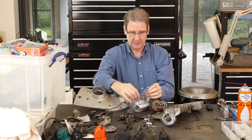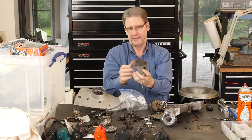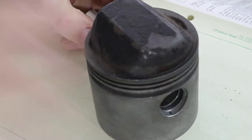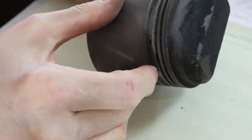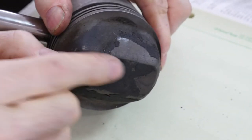Here's the piston we took out of that 82 in the earlier shows. Here's a Sportster piston. They all kind of — they used to be 900cc instead of 1000 — but they all look like this. And you can see it's got this huge dome on it. It's even got a little nick right here to let the valve clear.